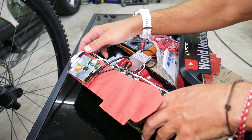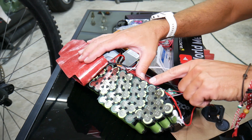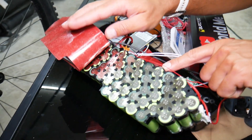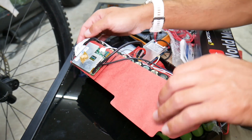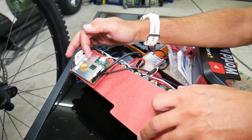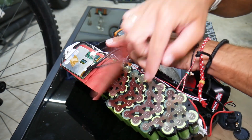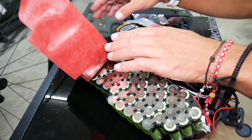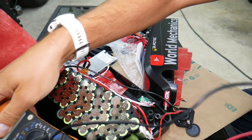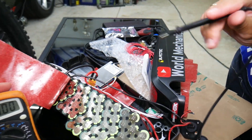Each group of five batteries — you can see this one here is connected to a positive wire, which is your charging wire. If you look right here, each one of those wires goes to the BMS. That's the one that controls that all the batteries should have about the same voltage across all the different cells inside the battery. If they deviate from each other, that's not good — that will be one of the first signs that you have a bad BMS.